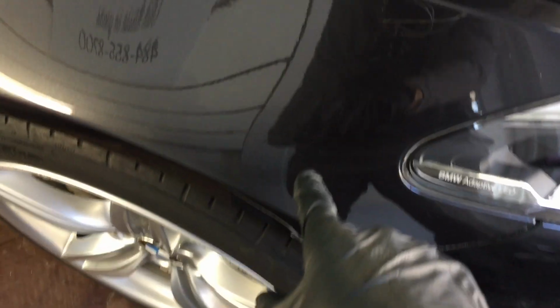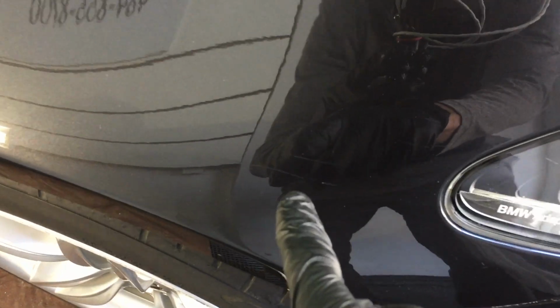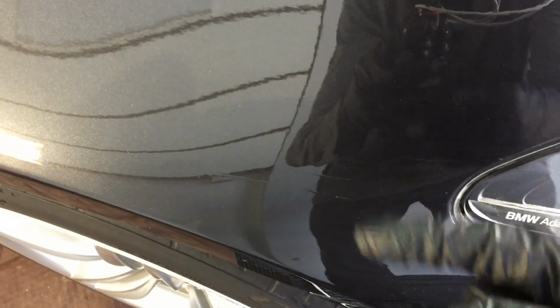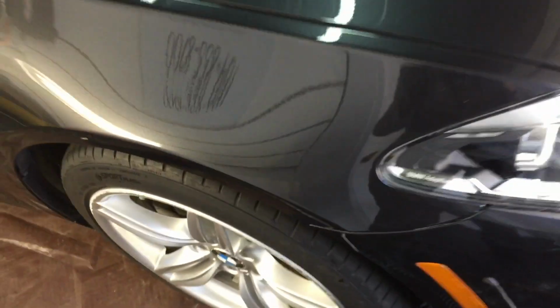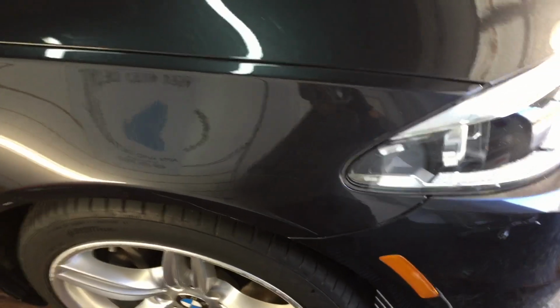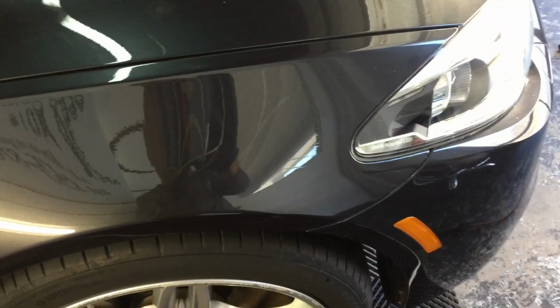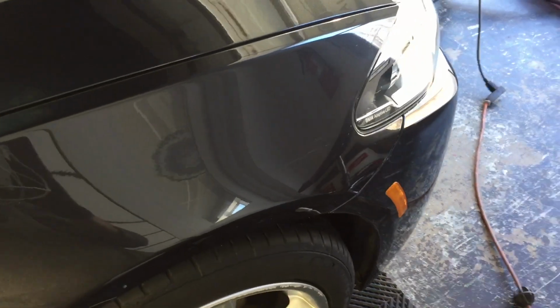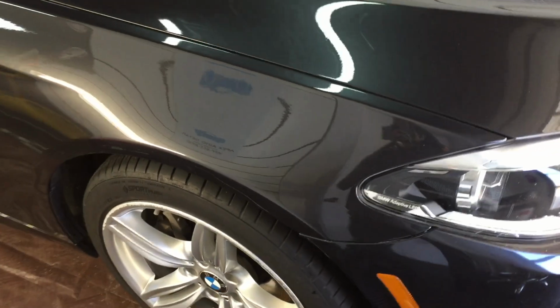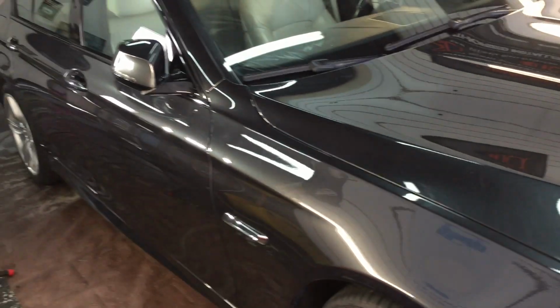The whitish looking color coming from within the scratch was the light bouncing around all those jagged edges in there. And as you can see, the gouges are still there, but we smoothed them out, we rounded them out, we filled them in just a little bit, and just a huge turnaround. But the most important thing, before we pull this out into the sunlight and take a look out there, that's going to be your harshest critic, is we did this without removing hardly any clear coat.